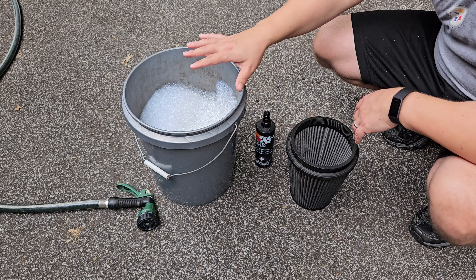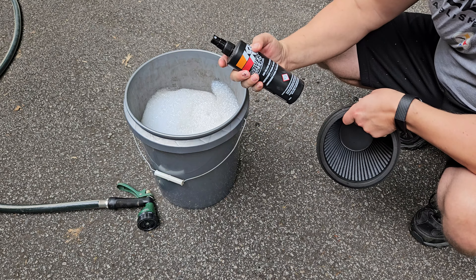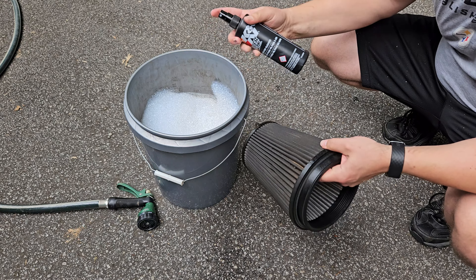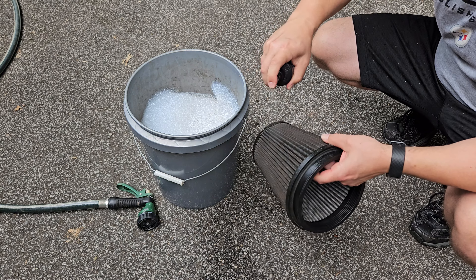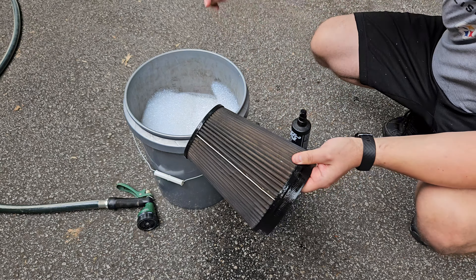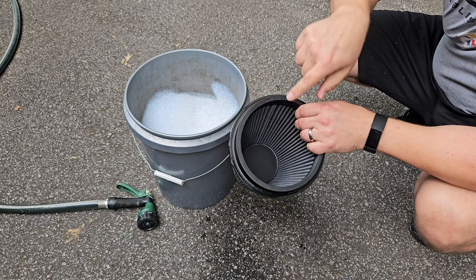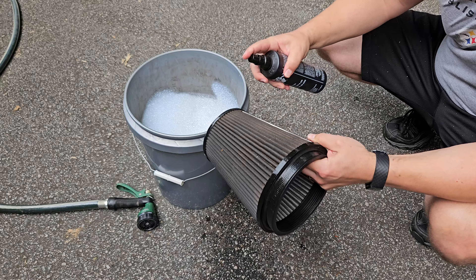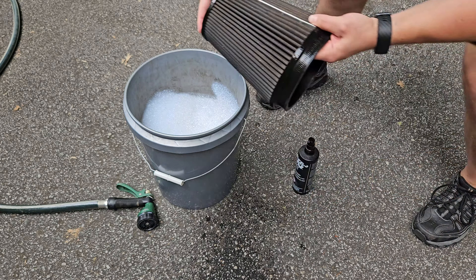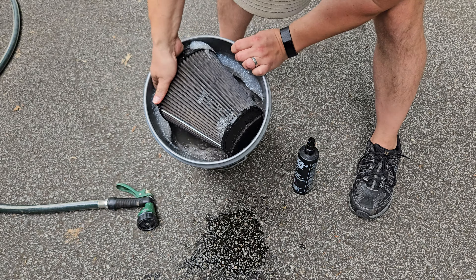Now what we've got is just a bucket of plain soap and warm water to clean the filter. I'm going to take this K&N air filter cleaner and spray it on the outside to help get some of that grime off. If you don't have this, don't worry — the soap and water will do just fine on these reusable filters. I'm only doing it on the outside. Remember that air is pulled in through the filter, so all the grime is on the outside. We don't want anything getting embedded from the inside, as that would then get sucked into the intake — you're working primarily to get the grime off from the outside.